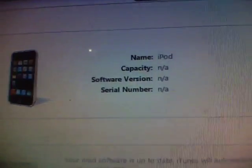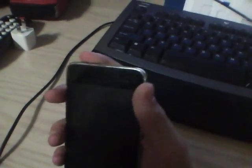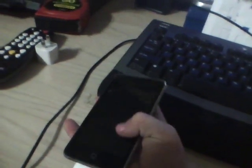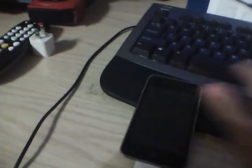I had to put it in DFU mode, and iTunes said you have to restore it — but no, you actually don't have to restore the iPod. Now, as you know, to enter DFU mode you hold the power button for 2 seconds, then hold the power and home button for 10 seconds, then hold only the home button for 15 seconds. I'm going to teach you how to take it out of DFU mode without having to restore your whole iPod.